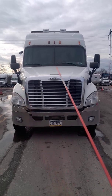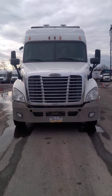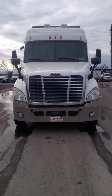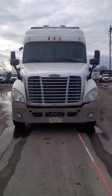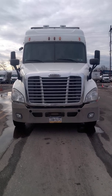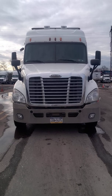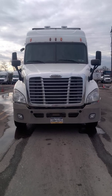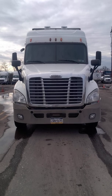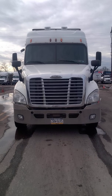My hood mirrors, side mirrors are properly secured, clean, adjusted to driver, no damage. My headlights, multifunctional. Low beam, high beam, markers, flashers, and signals are properly secured, working, no damage. That concludes our front cab, tractor, or truck inspection.